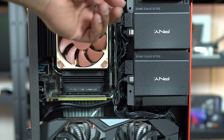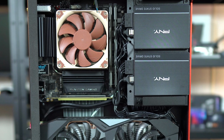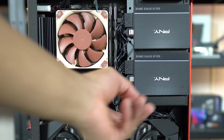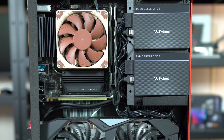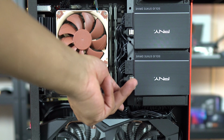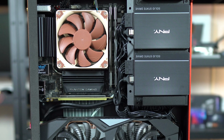The cables can be routed for the most part underneath this shell, or this bracket, that holds the hard drives and hides the power supply. Everything can kind of be tucked away for the most part. As you see, there's not a ton of cables sitting there. One thing I would recommend: get these little mini SATA cables that I got, little 6-inch guys, because otherwise they're going to be sticking out all over the place and taking up a lot of space.